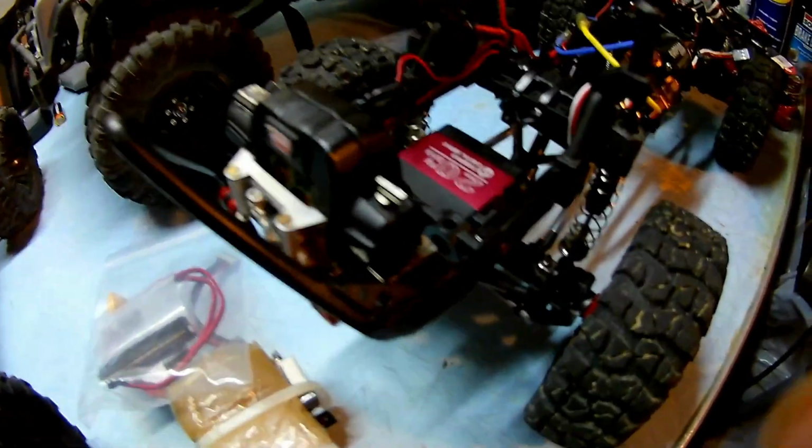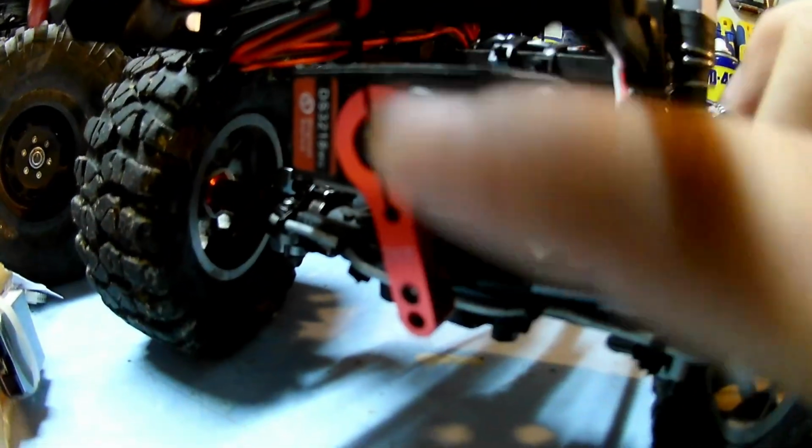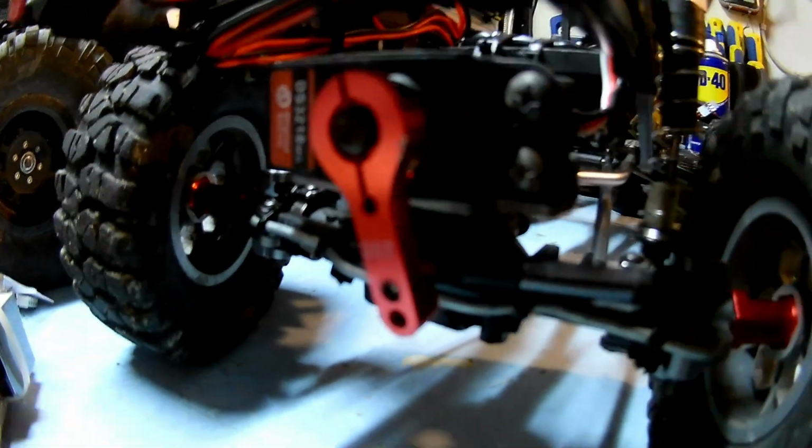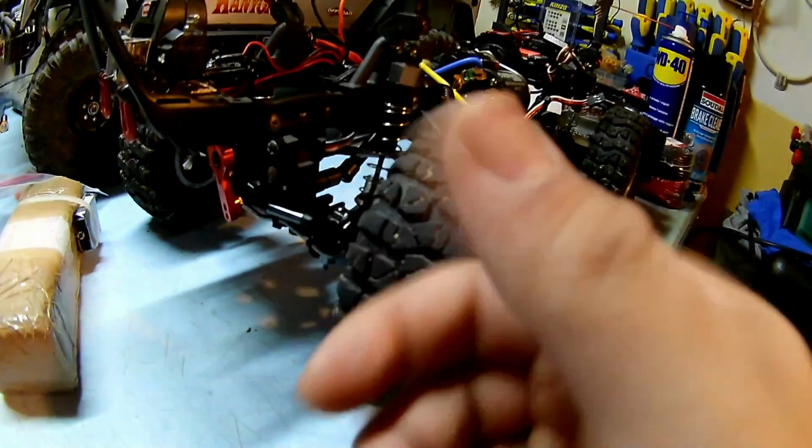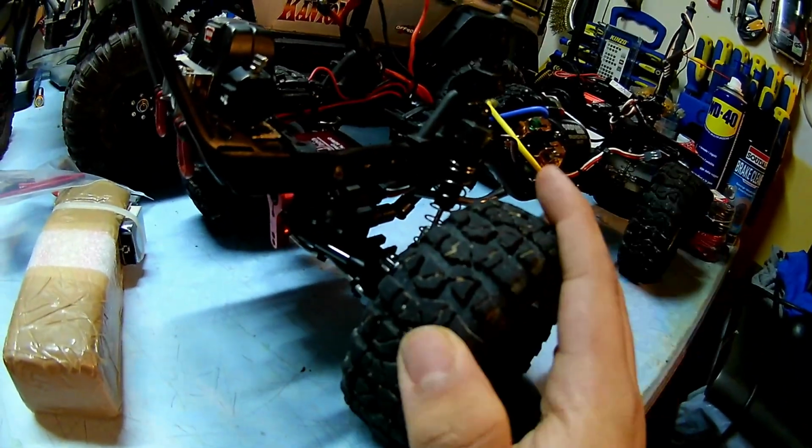And I also have the winch, as I told you, and it has an aluminum servo horn, 20 kilo servo. The stock one was 3 kilos. It has hex extensions, wheel spacers, and I just bought these recently. These are aluminum steering knuckles, which are really better than the stock plastic ones, because the stock plastic ones used to flop, they bend, and the steering was really horrible. If you steer, you have to look and then it would turn. It was really hard, but now it's great.